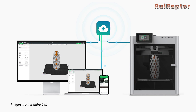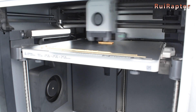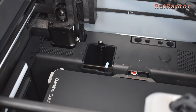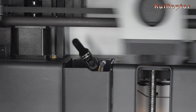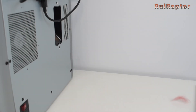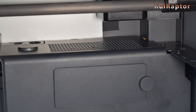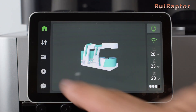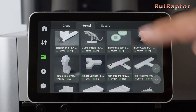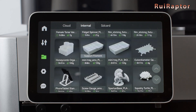It's equipped with Wi-Fi and cloud, which means we can access and control the printer remotely. At the left side there's a big fan for layer cooling, and there's also the nozzle tip cleaner and filament chute — every time the nozzle is cleaned or purged, the filament remains are dropped in this area and fall out at the back of the printer. At the back there's a fan pulling air from the inside out with an air filter in between. The printer also includes an internal memory with some already-sliced models stored locally, not on the cloud.